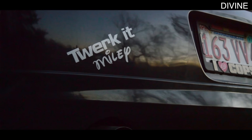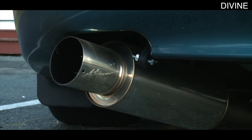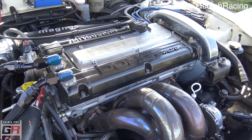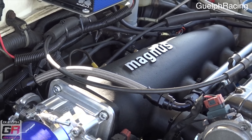In 1992, the US 4G63T was revised to match the Japanese market Evo, which featured different piston oil squirters and a lighter rotating assembly. In 1995, the second generation DSMs came around with a revised version of the 4G63T that now output 210 horsepower. Continuing their rally racing development, the 4G63T was eventually used in the Mitsubishi Lancer after Mitsubishi dropped the Galant VR4 in 1993. Over the years and different generations of the Evo, the 4G63T received a few revisions, each time making a little more power.